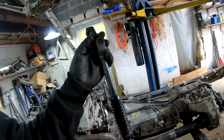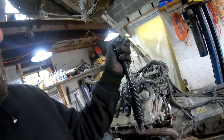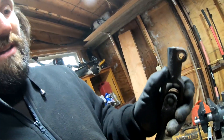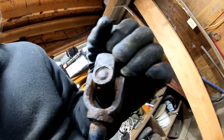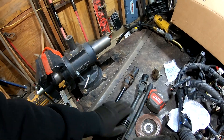This little guy right here — these u-joints go bad, by the way. I had to replace this already, and we just had a 2006 Tacoma in the shop, same exact truck but extended cab, and it had one of these that was bad. I saved it, so here it is. Look — it's jammed up, can't even bend it. I can bend it this way but it's really tight.